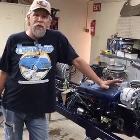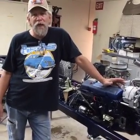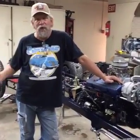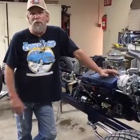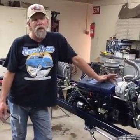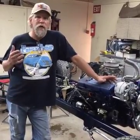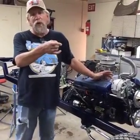just in case you got chased something down, the wires in the Easy Kit are both color-coded and it says on the wire what it is, whether it be the left turn signal, right turn signal, high beam, low beam indicator, which are the three wires that will all be up in your dash. You have your headlights. Remember, when you wire your headlights in, your headlights won't work unless you have the dimmer switch connected. So you need to make sure the dimmer switch, and that's just a plug-in on the Easy Kit.